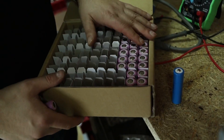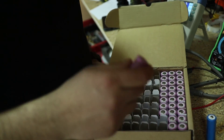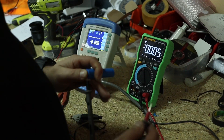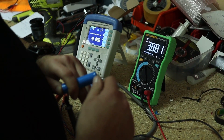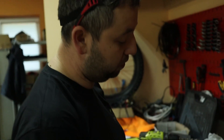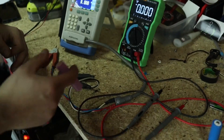When you buy brand new cells they always come in a box of 100. We have two cells — one Samsung, one Chinese. The Chinese cell reads 3.88 volts, close to 3.9 volts. Now we measure the inner resistance.